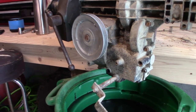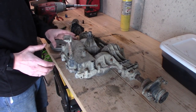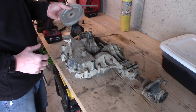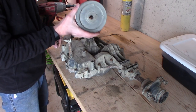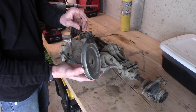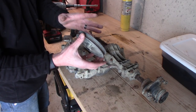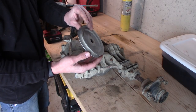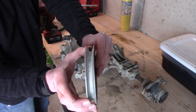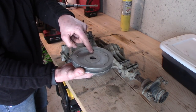Alright, it looks like she's pretty much finished spilling oil — let's get this thing on the bench and take it apart. I pulled the brake assembly off, pulled the spring out of the shifter detent ball, and got my pulley off. One thing I'll address: I do not recommend these aluminum pulleys. These cast aluminum pulleys are for fractional horsepower — basically less than a horsepower. I was using this one because at the time of the swap it was what I could find readily available, and I honestly forgot about it. There's no visible wear, and as long as your belt is aligned perfectly it should be okay, but go with steel any time you can.